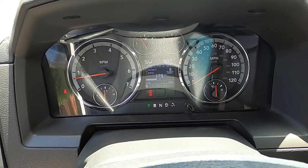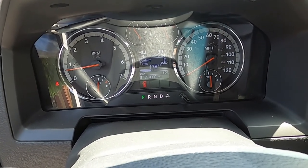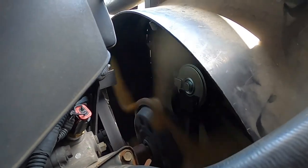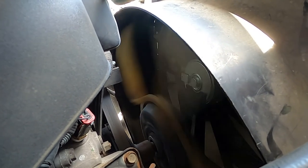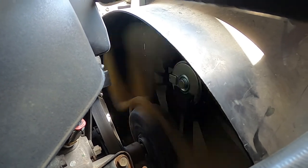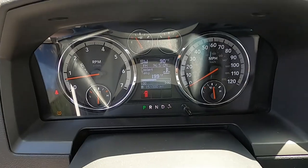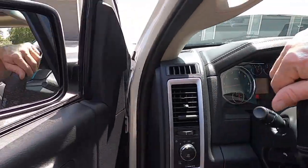We're getting pretty close — it's hot as heck out here. We're at 177 degrees. I've got a 203-degree thermostat, so when it gets up to temperature we'll see what we've got and look at that fan. Before this fan gets up to complete speed, it looks like it's spinning as fast as the engine — it looks kind of wild on camera. But as that engine gets hot and reaches 203 degrees, it should spin as fast as the engine is turning whether you're on the gas or not. We're at 199 — I'm watching the water disappear in the radiator.